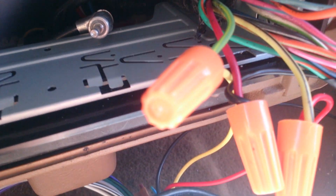And that goes to the red wire for this Kenwood harness. This green and yellow one goes to the yellow one on the radio harness. The ground for the Bronco is red, so the ground wire for the radio goes to the red wire.